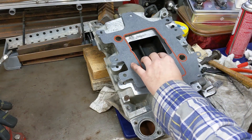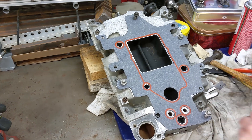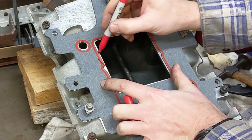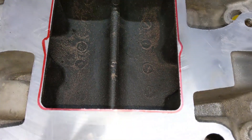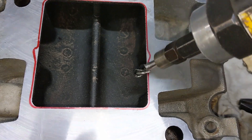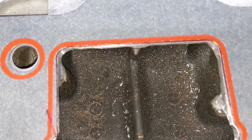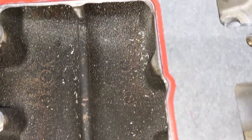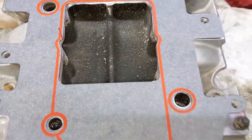Next, I'm going to go ahead and lay the supercharger gasket on the lower intake manifold, and then using a red marker, I'm going to trace the area around the plenum underneath the supercharger. Here's a close-up look of how much material is there that can really be removed. We'll go ahead and do that with the die grinder. I finished opening up the lower intake manifold — I'm not sure if it's going to make a difference, but it definitely removed a fair amount of material around the entire perimeter. In my mind, that really can't hurt, it can only help.